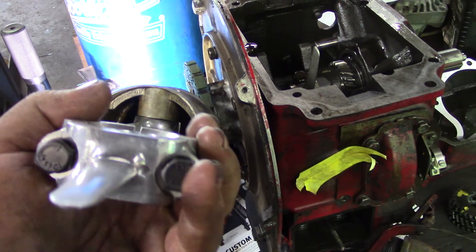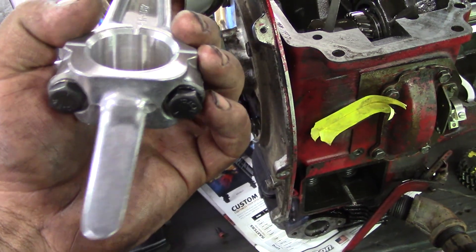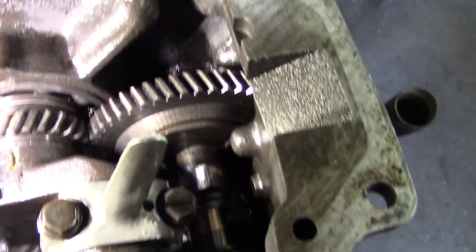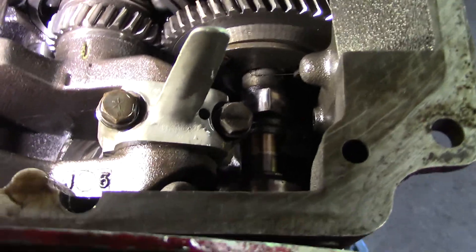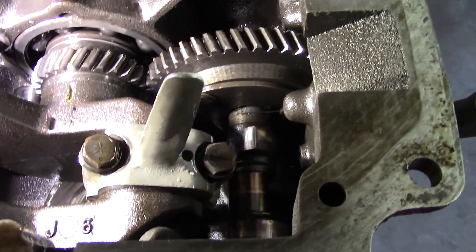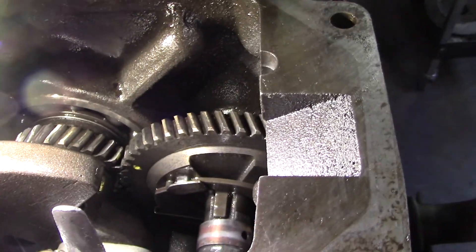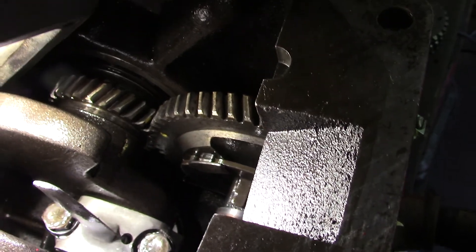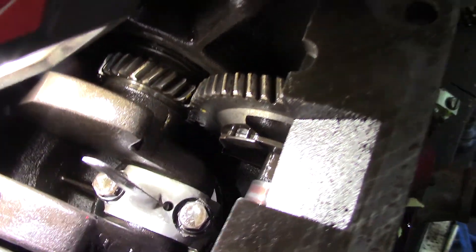They've been having problems with these because the torque here is 260 inch pounds on these bolts; used bolts is 200. But the factory torque on this — this is a '76 engine — is 285 inch pounds. That's why I'm using this rod; it looked really, really good, I figured why replace it? When you're installing, I marked the cam gear and the crankshaft with a yellow marker. Those are the timing marks, so when you slide that crankshaft in there, you want to line the marks up so everything lines up perfectly.